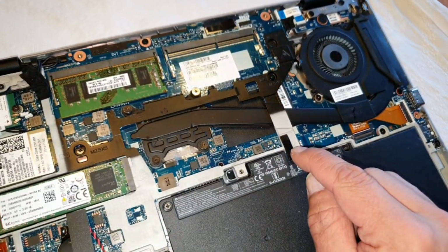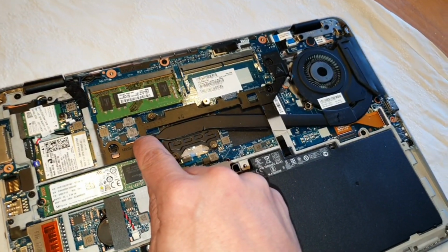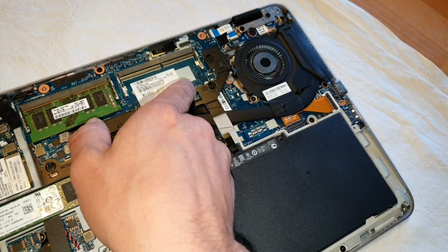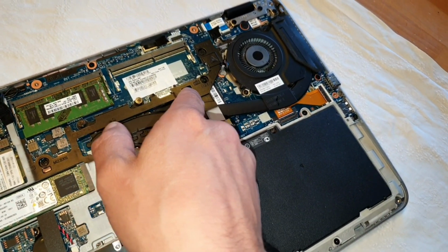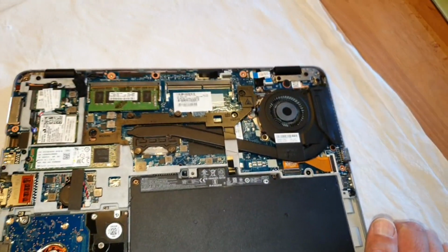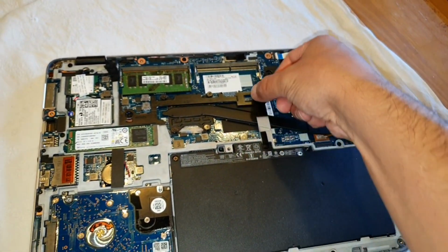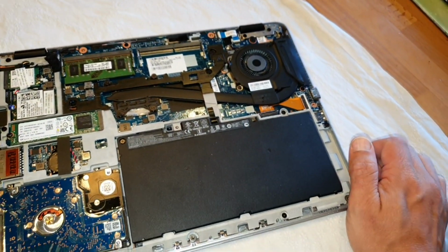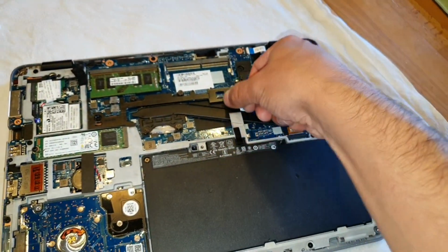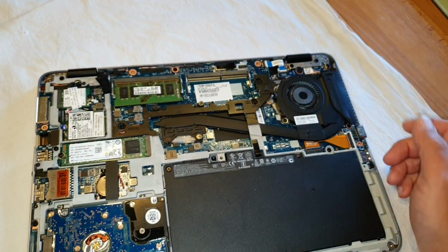And then you can, or let's say, wait, you cut it here, then you cut it here, and then you cut it here and here. And this was all, okay? You can do this all easily with a mini drill, okay? And just take care, of course, of the dust, because the metal part should not stay around or lie around here. You're gonna have a short circuit.